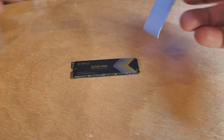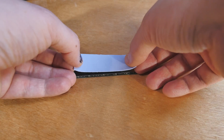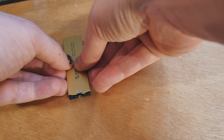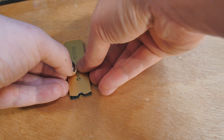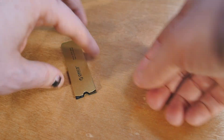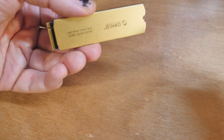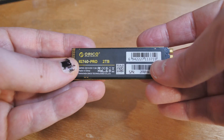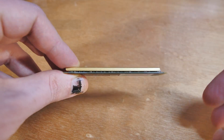I also reseated the heat sink that comes on it. That brings me to my next point: it does have a new innovative heat sink — you just sort of smack it on top and put it together like a sandwich; it doesn't require any rubber bands to squeeze it. I'm not sure if this is working as well as other heat sinks I've seen, because in my system it ran hotter than I'd expect. I even emailed them and they confirmed it's within spec and it didn't throttle. It ran a bit hot in my system; others say it ran cooler. The mini PC doesn't have much airflow, so you probably do need airflow around this. I wouldn't mount it directly under a GPU unless you put a bigger heat sink or a plate on it.